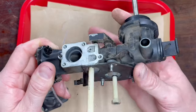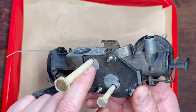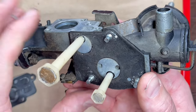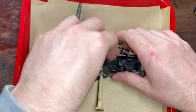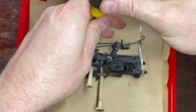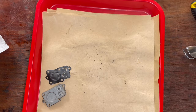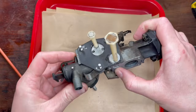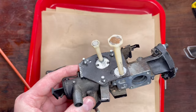That's how it works — it's really simple but we have to test a couple of little things here. These two plastic uptake tubes are actually held in place with an adhesive and if that adhesive starts to wear and there gets air leaks in here you're actually going to start to suck air. So let's now test the two drillings and these two tubes. Firstly we'll pop the main jet back in and the needle holder goes back in next, and then we want to put the needle back in and seat it all the way down. Only lightly — don't go really hard on it because you'll damage the end of that needle. I'm going to gently blow through and place some soapy water all around that little seal. I'm just going to double check and see if any bubbles come out. I've given it a good hard blow and I can tell there's absolutely no bubbles coming out. Some goes over that drilling — I'm now going to gently blow on the end. It's not making any bubbles whatsoever.